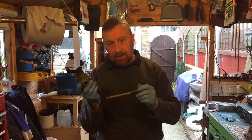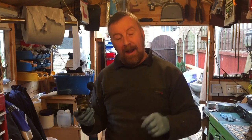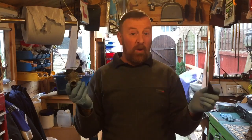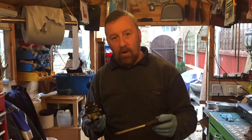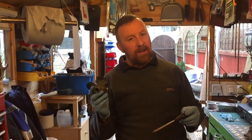Before you play with this, before you touch this, write down somewhere how many half turns you took it in or out to start. I always wind them all the way in - I know it's four half turns, five half turns - and if you muck it up and get it wrong, put it back to where it was. Let the engine run for a little while and it'll settle down. After adjusting each time you adjust, you've got to let the bike run itself in again, so about thirty seconds worth.